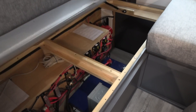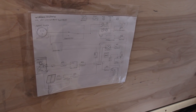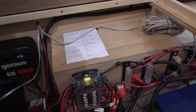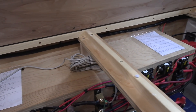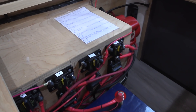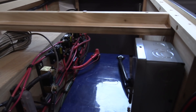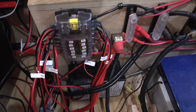On this side of the van, removing the cushion gives access to a hatch kept open by a strut. There are wiring diagrams left inside for the next owner. The wheel well dead space is utilized to incorporate all the electrical components: a 200 amp-hour AGM battery, the electrical breaker panel, and the fuse distribution box.